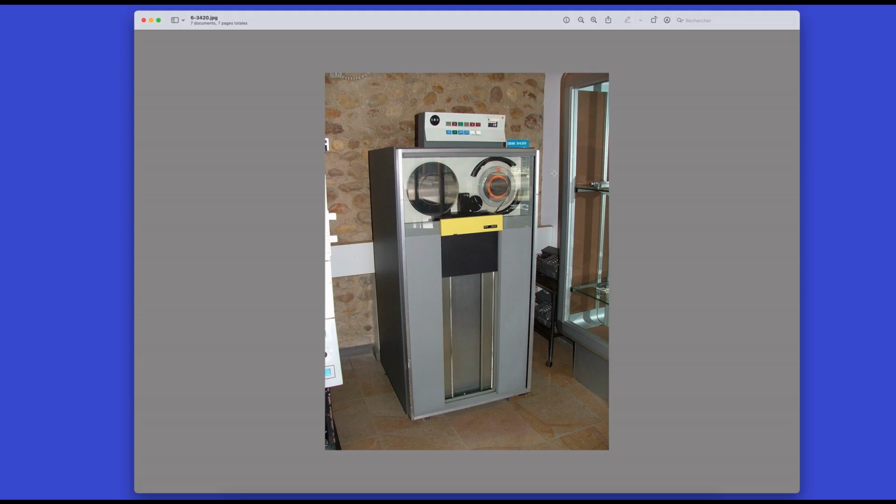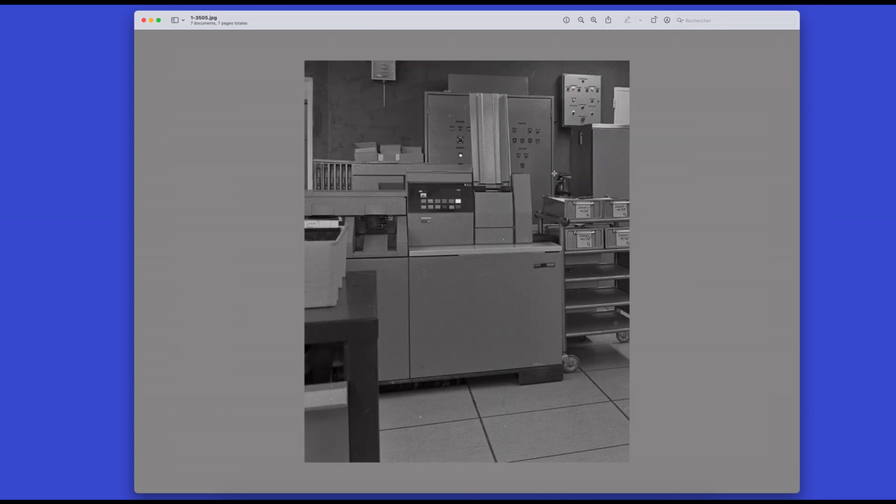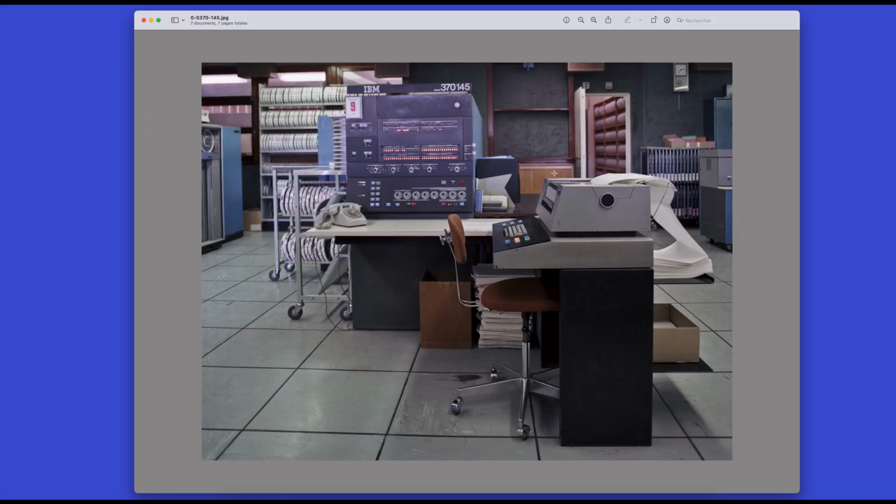This was a 3420. And finally, of course, to interact with the mainframe in any way, we needed terminals of different kinds. And typically, a terminal of the 3270 family, like this one. This is model 3278, I believe. I didn't work with that kind of model exactly. It was a different kind of model, not very far from this, but I remember a big room full of these terminals. They were connected to not a printer, a controller, and that controller was also connected to the mainframe, okay? So these were the hardware components of a mainframe, and these parts were typically in a computer room, which nobody could access anyway. And of course, the terminals were in different rooms on the campus, I remember, where you could sit and work with it. So this was a mainframe at the time, and that's the kind of stuff that Hercules will emulate in general.